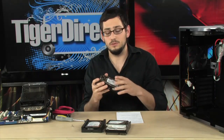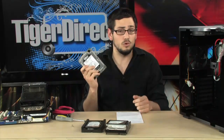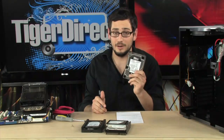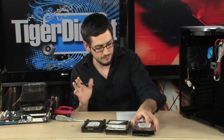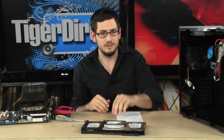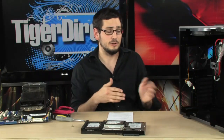A disadvantage of RAID 1 is that you're paying twice for the same amount of space — you're buying two 1TB hard drives but only have 1TB of usable storage. That's a very basic RAID setup. RAID is something that's a little more advanced; this is a beginner tutorial, so I just wanted to touch on it before moving on to physically getting the drive into your computer.